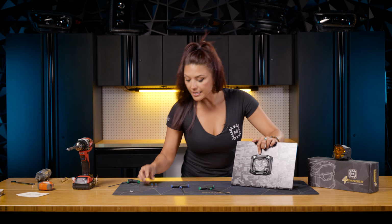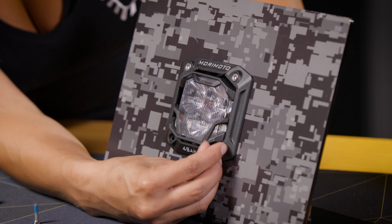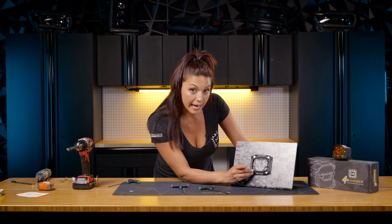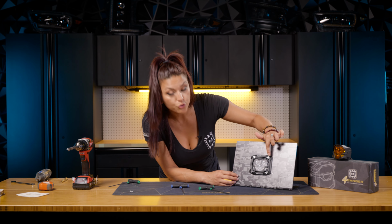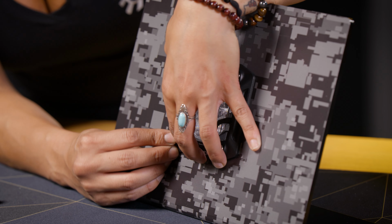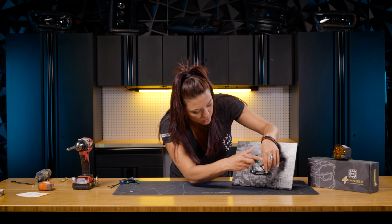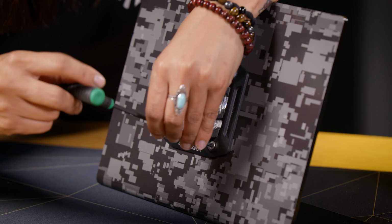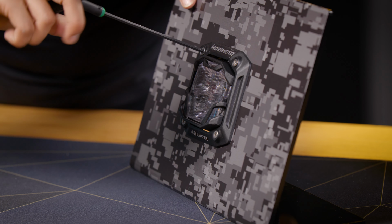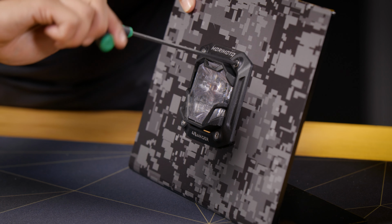it down into place. Go ahead and take the last 2 screws of your flush mount kit and put them into the last holes of your front-facing mount. Now keep in mind, if this does not go into place, that's okay. It's possibly because these 2 screws are a tad bit tight, so just loosen them up and then just finagle the actual mount until the screw goes into place. So now just take that T20 and just tighten those last 2 down. And this will finally allow the 4Banger to be fully installed in place. And then just go ahead and tighten the top 2 up pretty snugly as well, just in case they came loosened during the install.